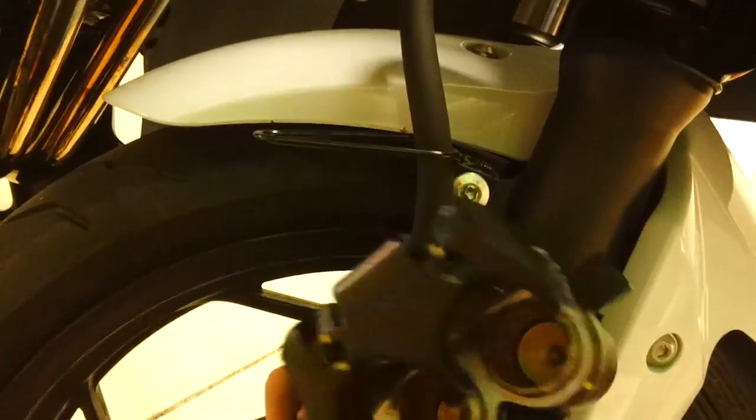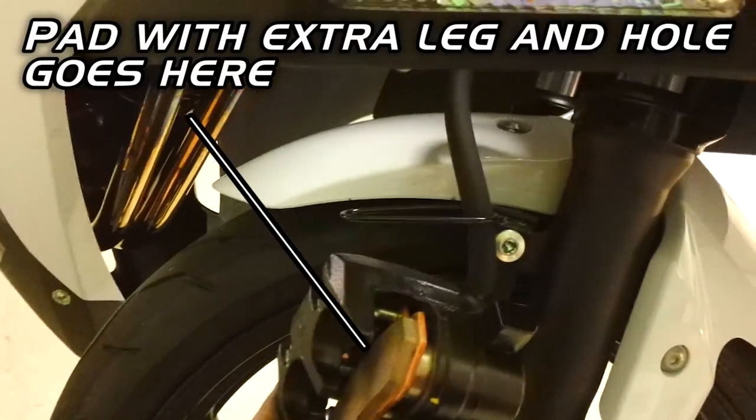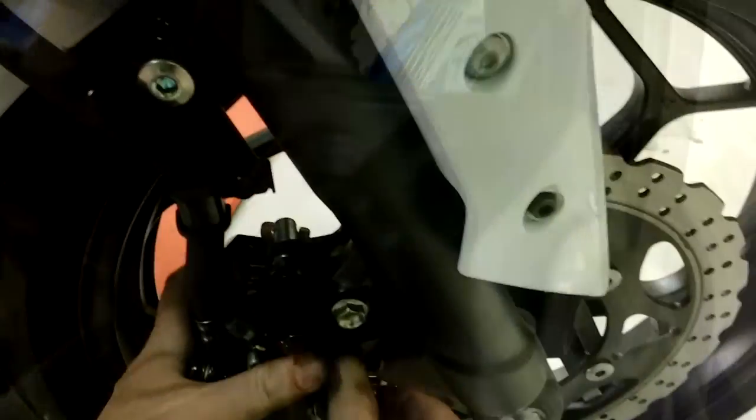There's the inside of it. Okay, and then you install your new... These are your new brake pads, so the inner one goes here. The one without this thingy here. Okay, here we're just trying to fit it on to the disc. And I don't know if I'm doing this right, but this is tricky, because the EBCs are a little thicker. Just took some finagling. Use the disc to help separate it.